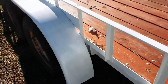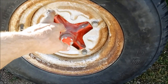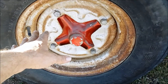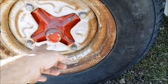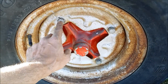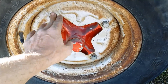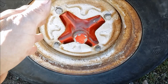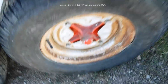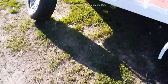We're out here at the old trailer and we're going to be getting rid of the 9.44 wheels. These wheels are based on 9.44 inches between the two bolts and were manufactured for about 40 years. Some were fully round in the center hole. The weight does not rest on the bolts — it rests on the hub — so the bolts are just there to hold it on. You get a very strong wheel rated from 2,500 up to about 7,000 pounds, pretty common in travel trailers, box trailers, and utility trailers.